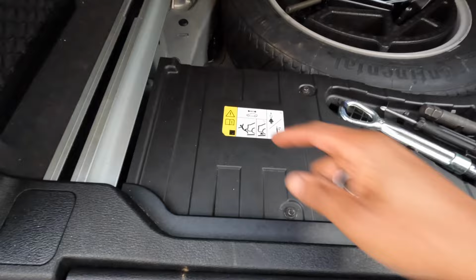So today we're going to talk about the BMW X5 battery replacement. Now, if you didn't know, your X5 actually has two batteries. The reason is that they have one battery to handle your normal loads, but there's a smaller battery to assist when the demand happens. Obviously, these cars have a lot of electronics in them. There's a lot of different modules that need to run. And if you're unfamiliar with the older models, they had to almost have them replaced quite frequently.